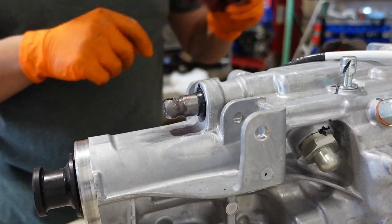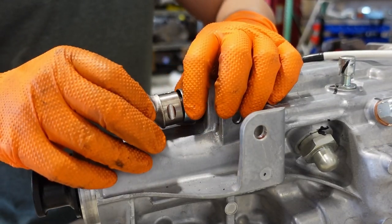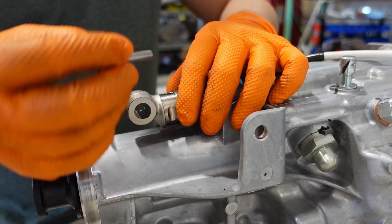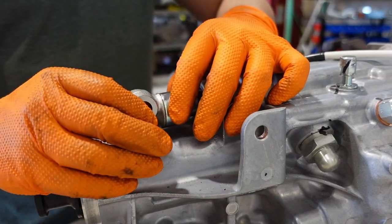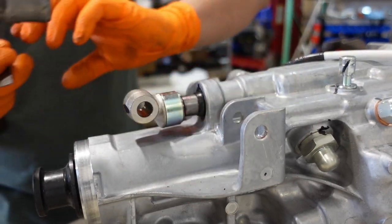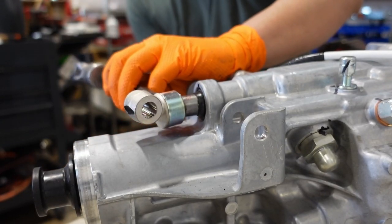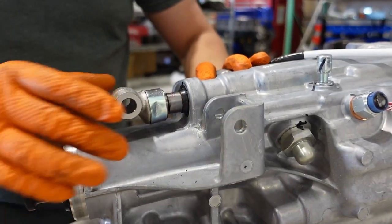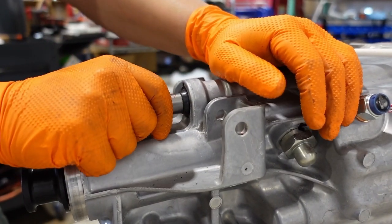Put a little bit of grease around the fulcrum joint on the shifter select shaft so you're not gouging metal to metal. I like to slide the crush collar in first, then bring the flex joint in and install the roll pin. Once the roll pin is seated all the way, slide the crush collar back onto the flex coupler. Take a hammer and chisel and stake the crush collar into place — hit it with decent force but don't overdo it. The crush collar should not be able to move backward by hand with considerable force.